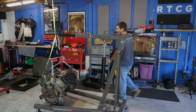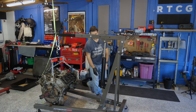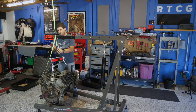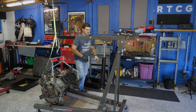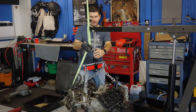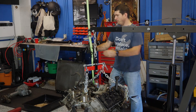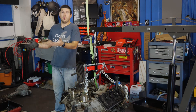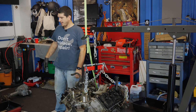I have my engine stand at the full weight. I'm going to pull it out just so we have more clearance and transfer the load leveler from my strap from my I-beam over to the engine lift. If you want to see more information on this lift, check out the upper right-hand corner of the screen where I have a review and an assembly video. The engine stand has wheels, but why move it around once it's mounted? So just put it near where you want it to be, and we're just going to lift this and throw it on.